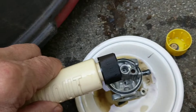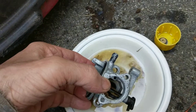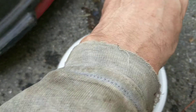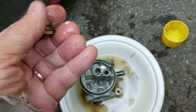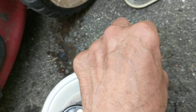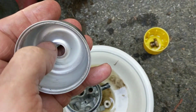What I did after the fact was pour the carb cleaner into the jets and let it sit there for several minutes. I poured it into all the different jets. The main jet on the bottom of the carburetor bowl I was actually able to put underneath the carb cleaner. I did find some sediment in the bowl, so that might have been the problem.